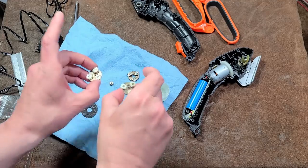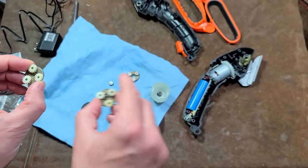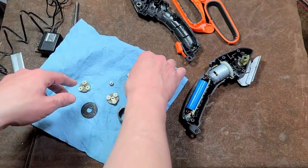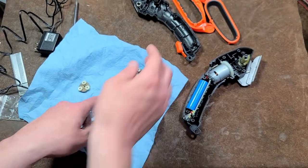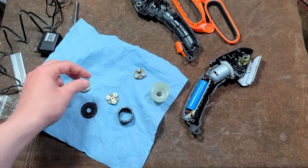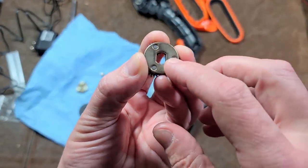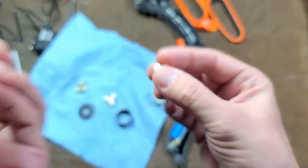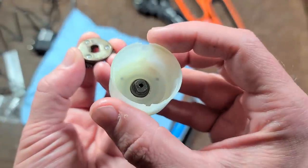The stages are symmetrical on the first two, so it doesn't matter if one's stacked on top of the other — you can't really assemble this gearbox wrong. Plastic gears on the first two stages; they are metal in the Skill. Only the final stage, where it has the highest amount of torque, uses steel gears — they're on slightly larger pins. On the motor, it is a steel gear because it uses a little D-drive, so it has to be steel, otherwise the little motor spindle itself would have just stripped it out. It also uses what's known as a double-D — when they have a round hole with a flat on both sides. That's how the output spindle is driven, through that double-D. The output gear is pressed onto the through-spindle so they didn't have to cut D's on it.